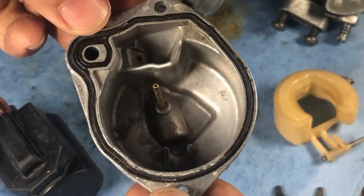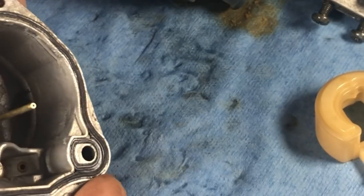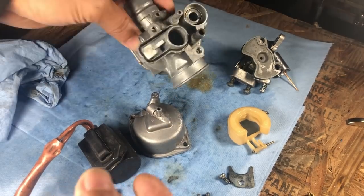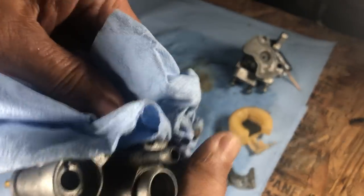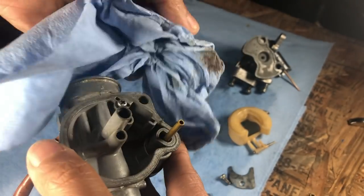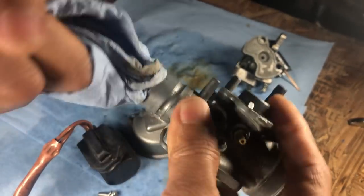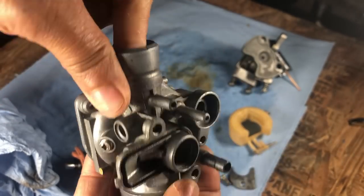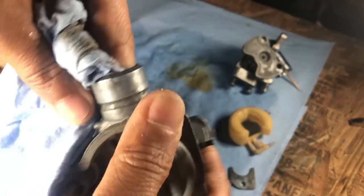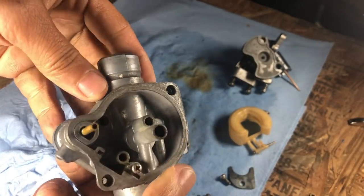I had to take it away for a minute and I took it inside and I cleaned it out. But it looks like whatever was in there must have been bad because it stained the bottom. If you can see the staining — I hit it with a steel brush and stuff to get it to clean, but there's no more gunk in there. After a re-inspection of the actual carburetor, other than some surface dirt, we look to have nice clear openings everywhere. I'll just rub some of these surfaces down. The part that goes into the engine isn't very smooth, but it doesn't need to be smooth on this part. I actually kind of want it rough here to keep the fuel from sticking to the sides of the carburetor. We look good.